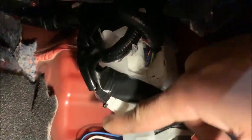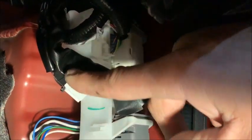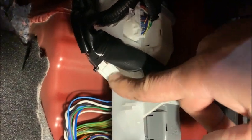Right there, in all this mess, this one's taped a little better than the other one. It was exposed. On the driver's side, it was not exposed. But this is the connector you want to get to. It's got 12 wires on it that match the color coding, which again I'll go over in the instructions with you. But you're going to cut it loose because I'm going to wire the accessory connector, and when I'm ready I'll plug it in. So let me get ready to drill the hole on this side, and then I can get it rust proofed and finish the install tomorrow.